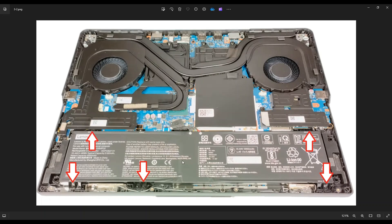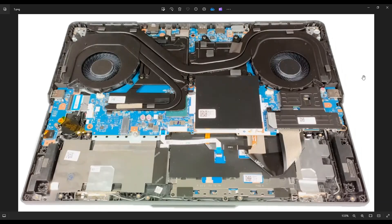After taking the screws out of your battery, there's the battery plug right here. Some of you may see a black piece of tape on it — just peel that back and wiggle it out of that port. Try not to pull on the wires if you can help it; just manipulate the plug. Put your fingernails on either side of the plug, or use a pry tool, and wiggle that out of the port. After you have removed or at least unplugged the battery, it's safer to proceed further into the computer.